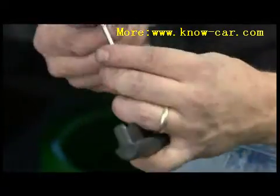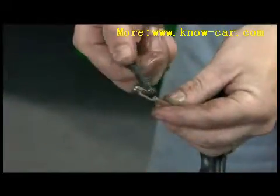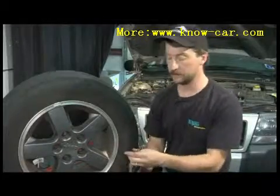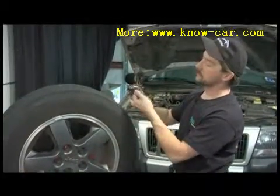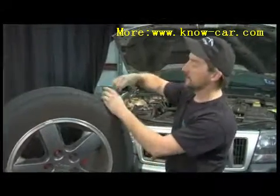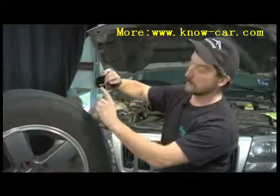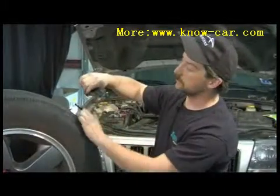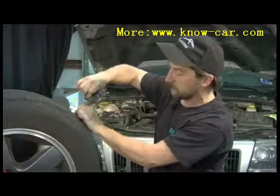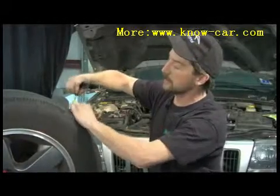Take your little slime here, put a little slime on top of this. Obviously I'm not going to put this inside the tire because I don't have a hole, but we're going to show you for demonstration here. Just make sure it's nice and smooth all the way around the outside, and you push this down in the hole. When this point goes down in, it's got an opening on the tip of it, and it goes down inside — this cork, as you would, would stay in there, and when you pull this back out...